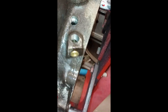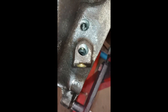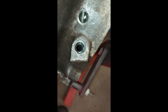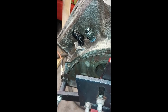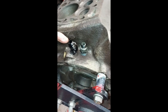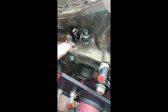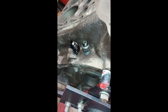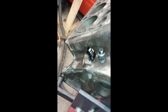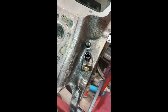All we're doing today is blocking off that passage — there's a plug inside you can barely see that keeps oil from going up that passage. Here it is with both AN fittings mounted. You can put the fitting here or here and the plug here or here — you could even put the oil pressure sending unit there, whichever way you want to do it. Just a matter of keeping track of which ones are in and out.